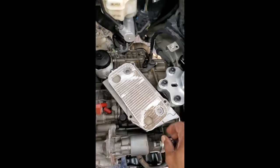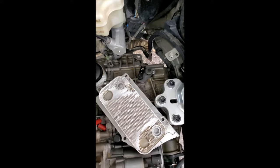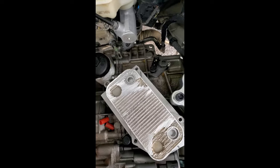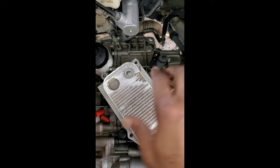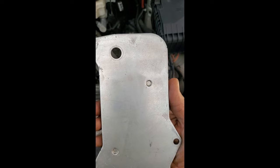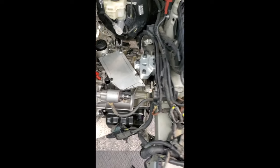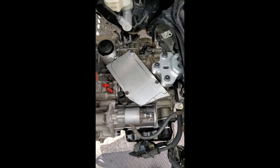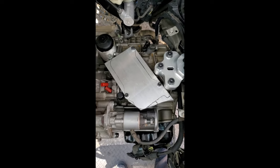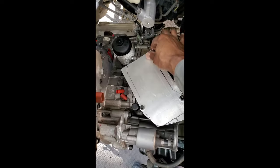The next set of holes I need to drill are the crucial ones — this is where my oil flow is coming from and returning to, so I want this directly centered. The importance is that it seats properly over the O-rings so we don't have any leaks. You can see the little circle pattern around both holes where the O-ring was pressed against the aluminum plate — that's what I want here. The plate is a lot thicker, so less chance of bending or flexing. If we need to lighten the car later, we can always drill bigger holes and go for a lighter plate, or by then someone may have come up with fittings that just pop directly into place.